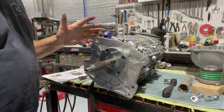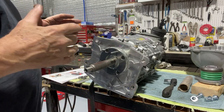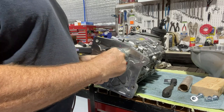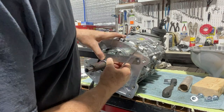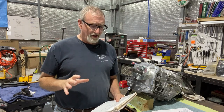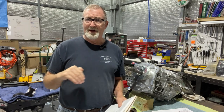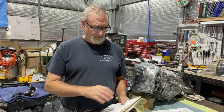We write that down. We've already measured from the face of the bell housing where the transmission will mount to the fingers on the pressure plate, and we've taken that number down. Working on getting the hydraulic bearing cushion measurement, we took the measurement off of the back of the bell housing as it was mounted to the motor — from the flat edge where the transmission mounts to the pressure plate fingers — and that figure was 3 and 7/32 inches.